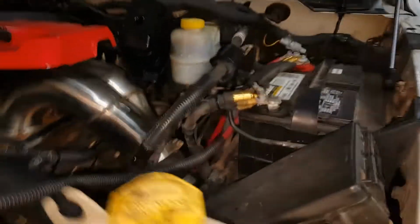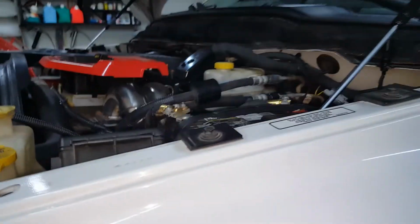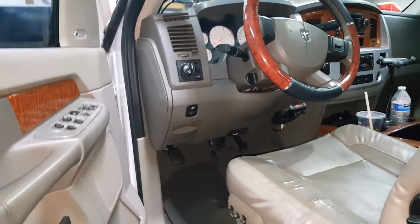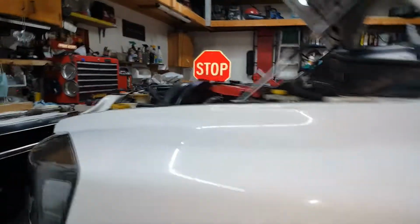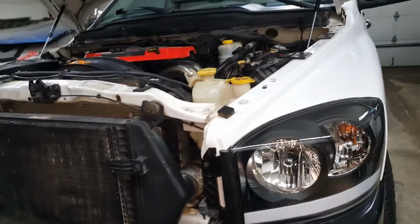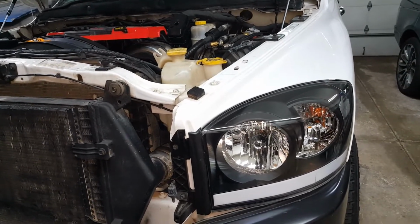So I was able to take it for a test drive. Steering feels great. The popping sound from the steering when turning is gone. I do still have a slight vibration in the steering, nothing too bad, which was there before. It seems to be actually a little better. I think that may be coming from the driveline, possibly my front drive shaft. So that's something we can take a look at, maybe possibly in the next video. But that shaft did make a big difference. Steering wheel feels very smooth, no issues turning, no popping noises like it did before.